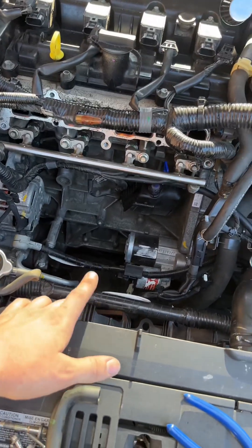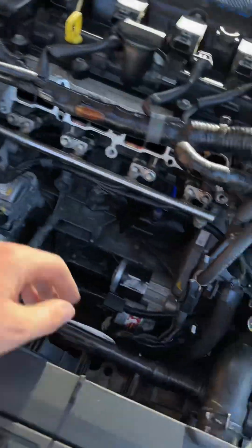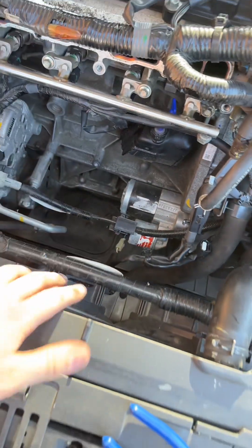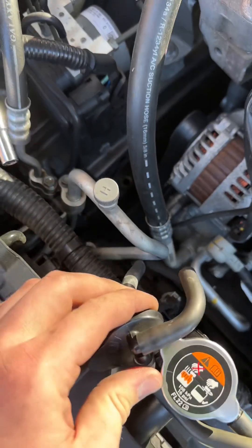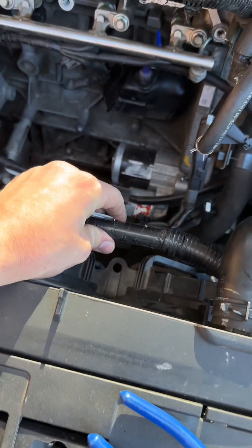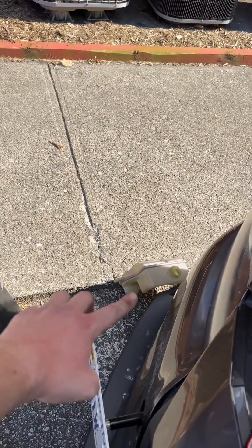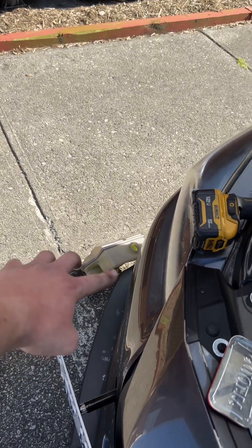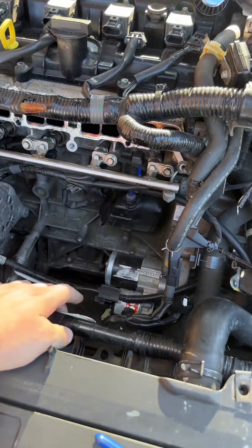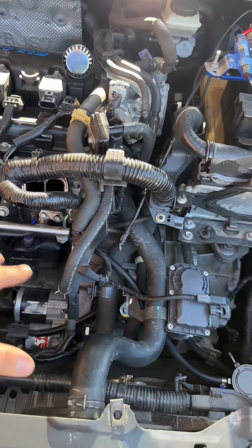As a side note, it is easier to get the intake manifold off of the vehicle if you remove your coolant overflow. It's actually just pushed into here - it holds on into this tab, that tab, and that little hole down there in the bottom. There's no bolts for it. Just go ahead and pull off your cap, set your hose and everything here to the side, and then just pull straight up on this. This wire loom here does run kind of into the overflow right here, so you can see that cut out. You might have to scoot that to the side, but besides that, it's not too bad. And then you can get in here and kind of rig everything up.